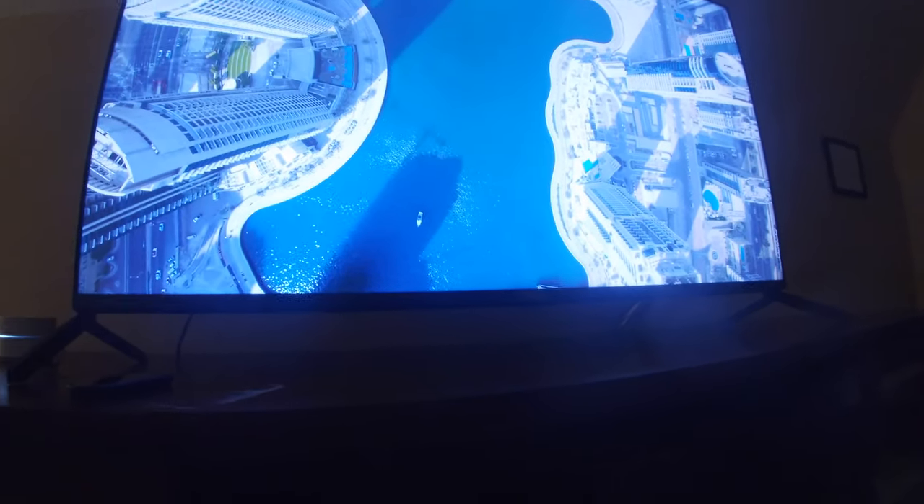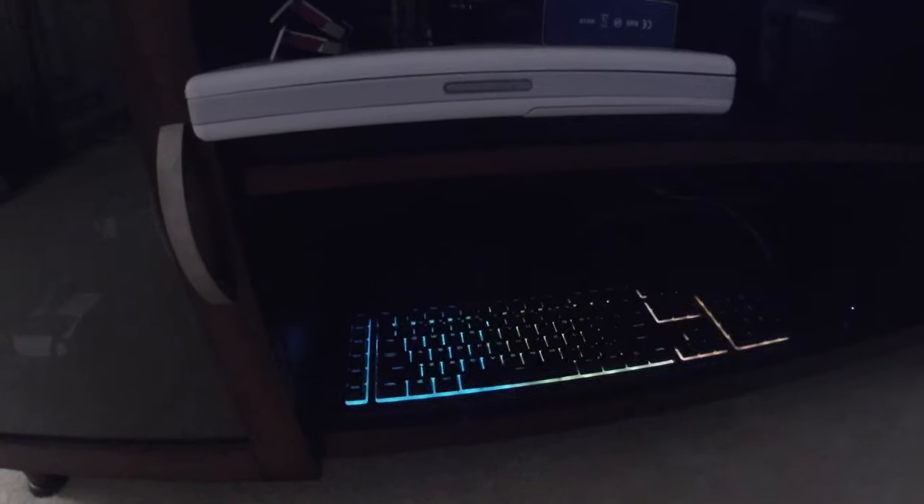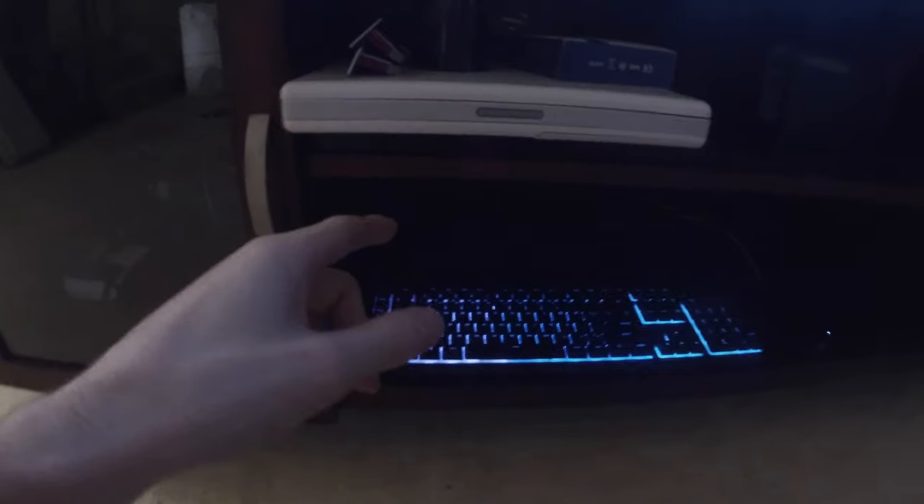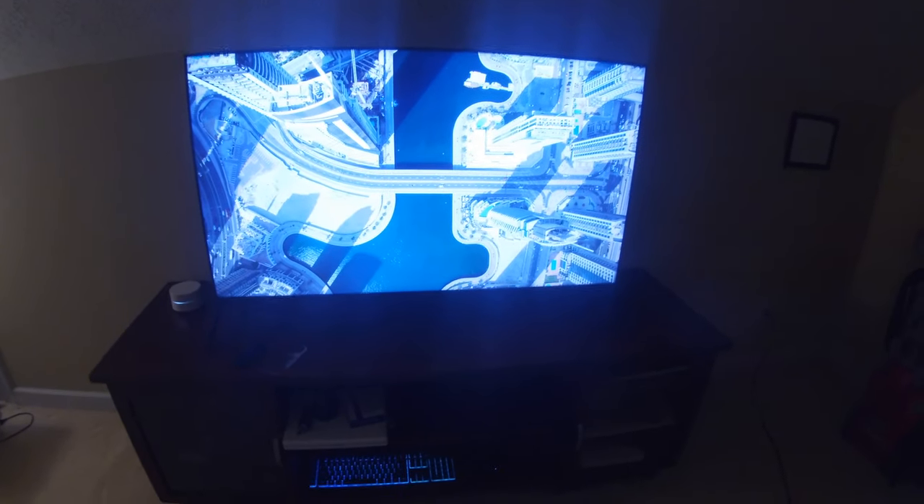One thing I've also done over here — I know it's hard to see since I'm using my GoPro and there's not much light — but in here are all the cords. We have the power strip right here as well as an ethernet switch. Everything is hooked up via ethernet: the TV, the Apple TV, and the Steam Link. One issue I was having with the Steam Link on Wi-Fi was I was only getting about 30 megabits per second on the transfer, so there was a little delay between my PC and the video on the TV, making it hard to play games. With ethernet, that is pretty much resolved — it's running from this switch to a switch that my computer's plugged into, so it almost basically has a direct connection.